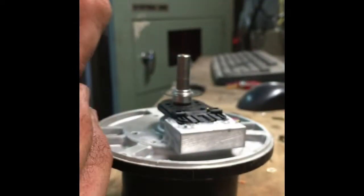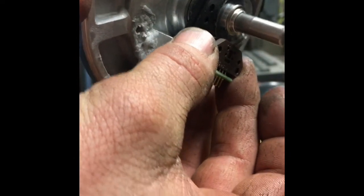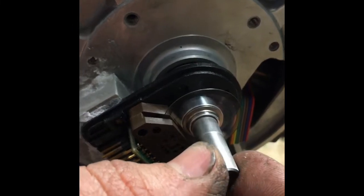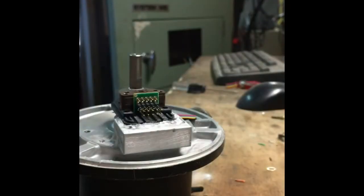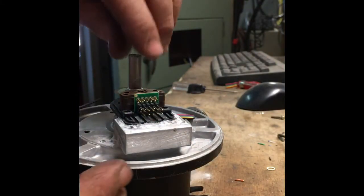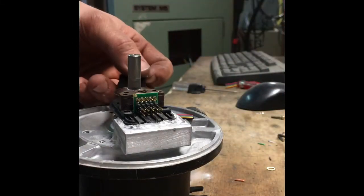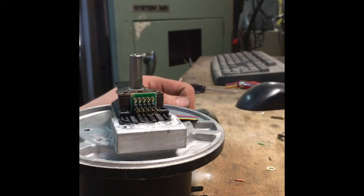This is the device that reads the disc, and it slides right in here like this - butterfingers, let me get that. It slides in there just like that and you press it down. I think it needs to go down just a little bit more; I think our spacer is off. So we're going to loosen that little disc and push it down just a little bit to get the right gap.